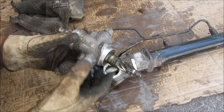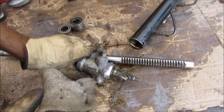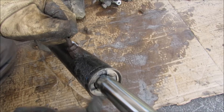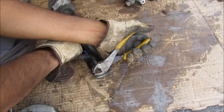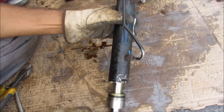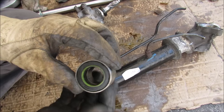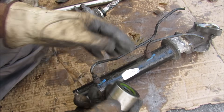You can see this is the pinion gear and the input shaft that spins it. I'm just going to use a cloth to clean off the grease from the pinion gear. Over on this side we've got a cylinder end stopper held in by a wire, so I'm going to remove that wire and then the cylinder end stopper itself. This black piece that goes around is the oil seal. When your mechanic tells you the steering rack is leaking, it's actually this bushing and this O-ring that are leaking.